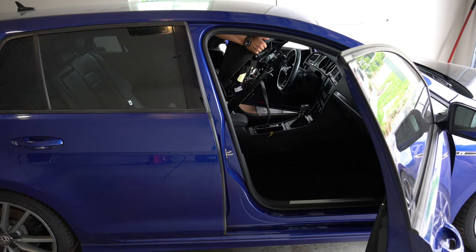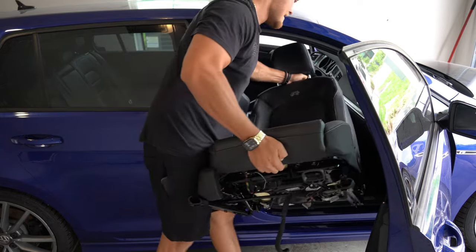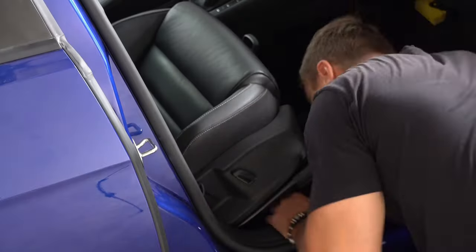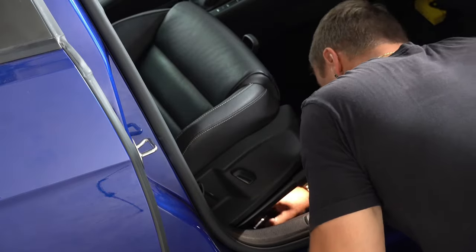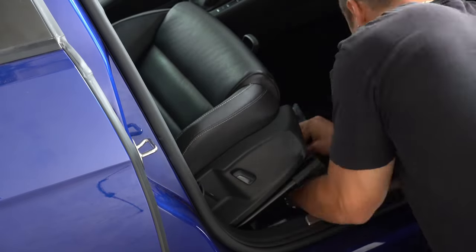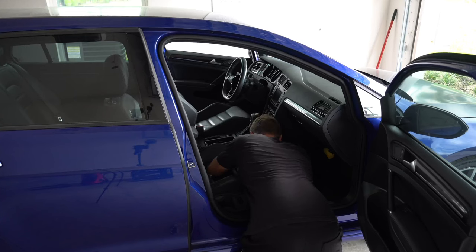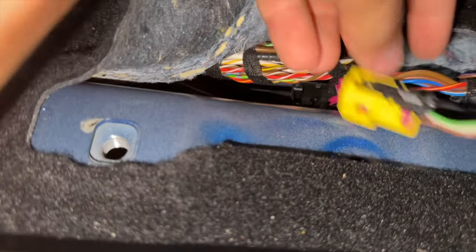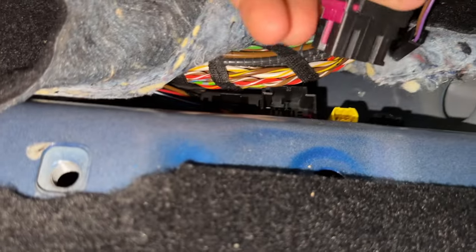To start off today's list of things that need to get done, I began by putting both seats back in the car. I started reassembling the passenger seat first because it has manual controls. I reconnected the three plugs that go underneath the carpet and then tightened down the four bolts that hold the seat to the floor. I did the same to the driver's side. Remember, anytime you are working with wires, it's a good idea to unplug the battery — especially with yellow connectors, as those usually indicate airbags.